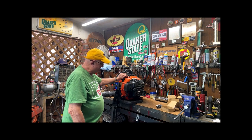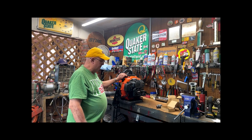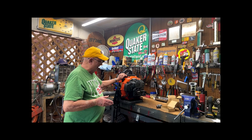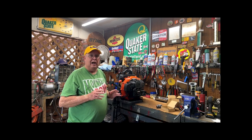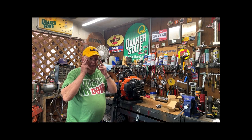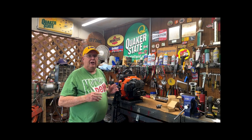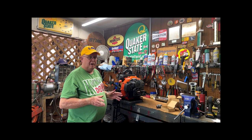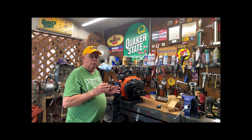So when we got back, I started reassembling it. I had gotten a new carb put on it, and I put it back together, and it would not fire. Actually, I did get it to fire briefly on the starting bench with starting fluid. I finally got it to pop off, and it would rev up and stay revved up, but it wouldn't slow down.